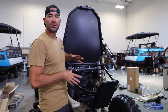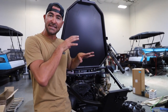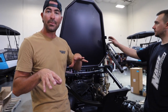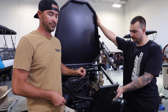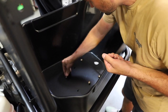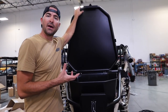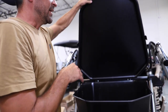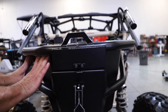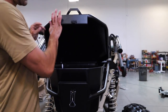We're shipping these with the lid attached to the frame, holding pretty secure, but I recommend having someone else hold it. We're going to remove the two carriage bolts we put in place temporarily, then install the plastic tub. Inside the plastic tub we have an inner plate and carriage bolts — carriage bolts go face down. Install all eight of those and secure all the nuts underneath. With carriage bolts face down you get as flush a surface as possible; the lid should close and hit against the strike pad in the rear, with a slight gap by design — all weight rests on the frame itself.